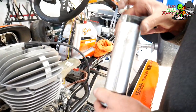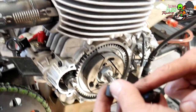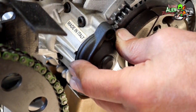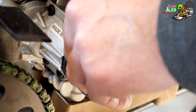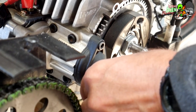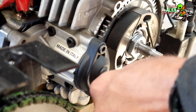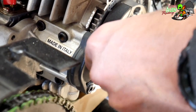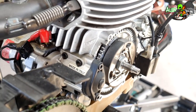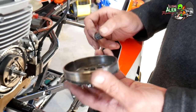Clean the cover for the bendix. I always like to put a little bit of lithium grease on the shaft to keep it nice and lubed up, then put the two screws back in. You need to check that this cover stays snug — it is just a plastic cover but if it's loose the bendix won't engage correctly. It holds everything in place. All this is pretty dirty, so take some brake cleaner to clean it and re-lube the bearing with some lithium grease.